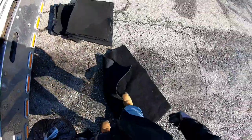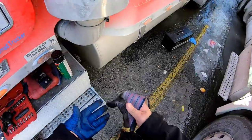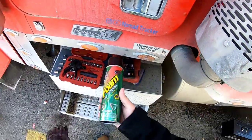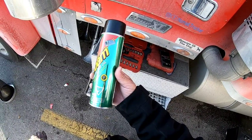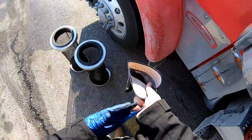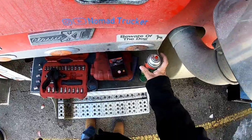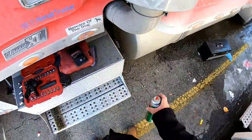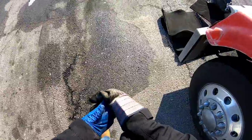I'm going to spray the top of the first coat with oil. This is the foam air filter oil I'm supposed to use here. I've used the K&N air filter spray too — the red spray — I kind of like that better just because it sprays more evenly. This stuff comes out in like a stream, and I don't like that because then I've got to rub it in. That's what I'm saving this other glove for.